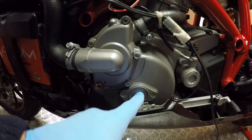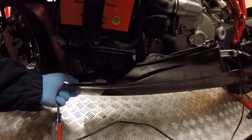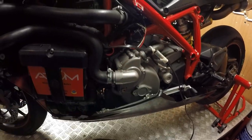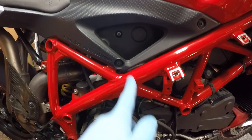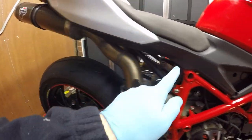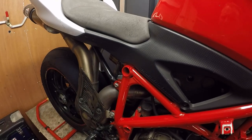This side gives me access to the turning gear cover — I've not had to take the lower fairing panel off because it's secured back here so I'm leaving that as is. On this side I can now get into the lower belt cover. I just need to clear access for the upper belt cover, so I need to get rid of this side of the seat unit — take the seat pad off and then remove the right hand side panel of the seat unit.